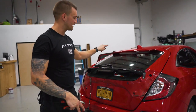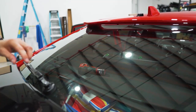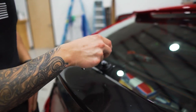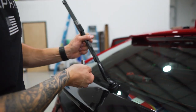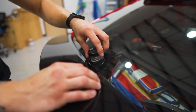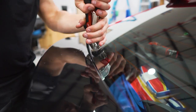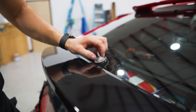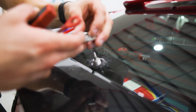Since we have the trunk closed, we'll move forward with taking the wiper off. Remove this cap, lift it up, pull it straight out. This is a 10mm, and instead of using the impact gun, I'm going to use a socket so I don't damage the window — the last thing you want to do is vibrate glass. Break it loose, take the nut off, lift the wiper up, give it a little wiggle, and it comes right off. Now take this plastic cap off, then there's a big nut — use a pair of vice grips, put them on the sides, grip it, and twist. It's never really too tight. Once loose, do it by hand. Put that to the side and take off the metal piece. Make sure you keep them in order so you remember how they go.